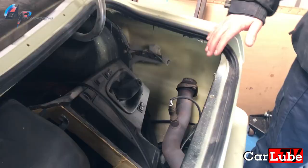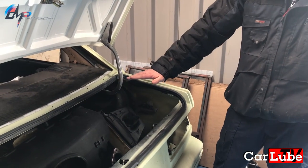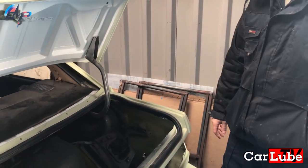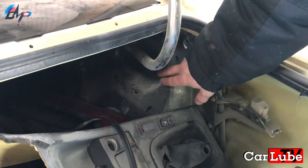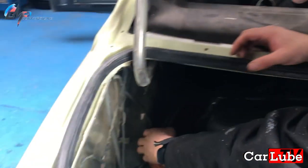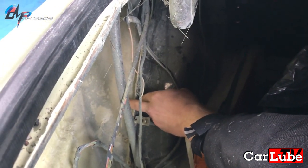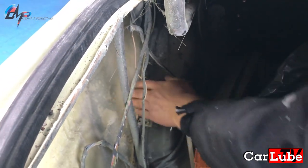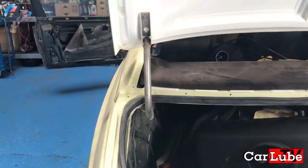Anything which is fiberglass in the back end of this car — we are literally going to be left with the boot floor, a parcel shelf, and the C-pillar internal parts. The very inside inner arches should stay in place — we don't have to touch them. If you look at this arch, the very inner part stays; it's the very outer part at the spot-weld joint that we're removing and replacing with the carbon part, and then the outer part with the steel part.